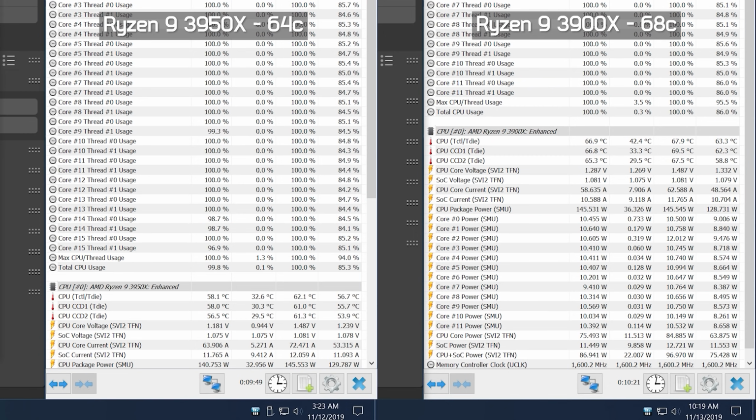Again, due to very limited time, I don't have a whole heap of thermal data for the 3950X, at least not with a range of different cooling solutions. For now, I just have thermal data with the custom Corsair HydroX loop, and for comparison, I have the Ryzen 9 3900X. Stock, the 3950X peaked at just 64 degrees after an hour-long Blender stress test in a 21-degree room. The CPU ran at 1.15 volts and maintained a clock speed of 4025 MHz by the end of the stress test.